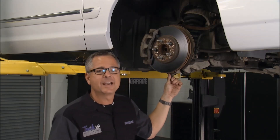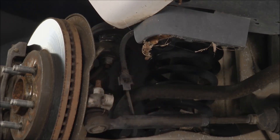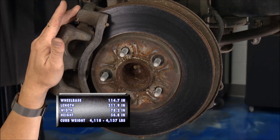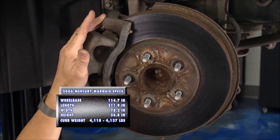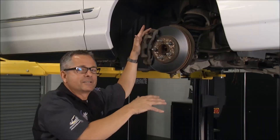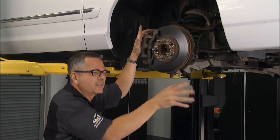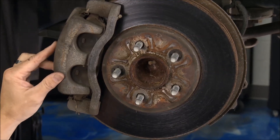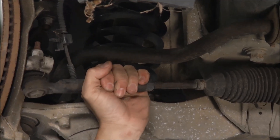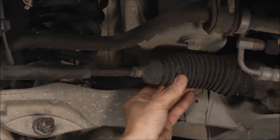We got Project M&M up in the air with the wheels off and we're ready for an undercarriage inspection. Besides being covered in spiderwebs from sitting so long, it looks pretty good. Looking at the rotor assembly — I told you earlier it had a brake pulsation. It actually still has the factory clips on the rotor from the assembly line, so these have never been touched. We'll probably replace them — they're rusty and we had a pedal pulsation. Our pads are looking pretty good though. Looking at the suspension, I checked the tie rod end pulling up and down — it feels good, the boot's not torn, and the bellows boots and the rack are all secure. We're in good shape with the steering.